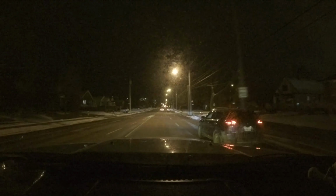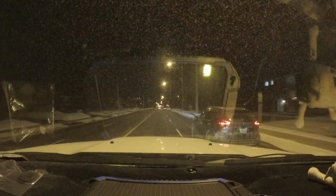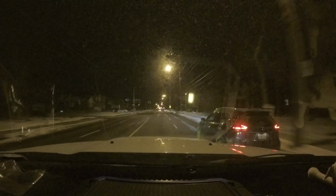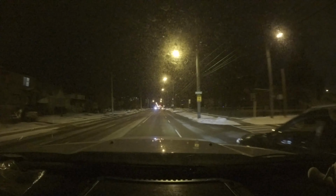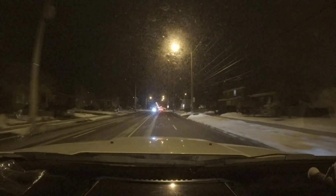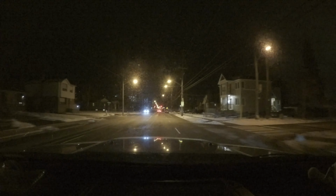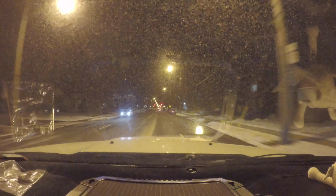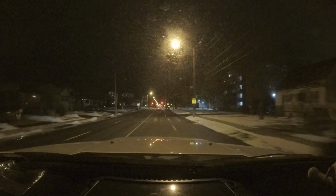Vehicles have different weights, front and rear, side to side, so those tires tend to bulge a little bit front to rear, side to side, which means that it is going to cause the driveline to bind up. And then again, in dry surfaces, such as the video you're watching right now, this is basically city driving. You do not need four-wheel drive, because there's plenty of traction for the drive wheels.